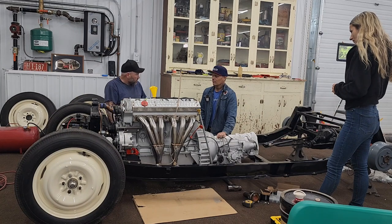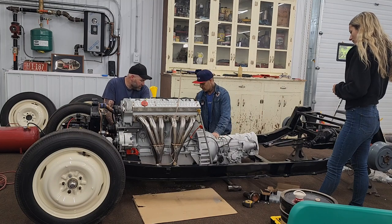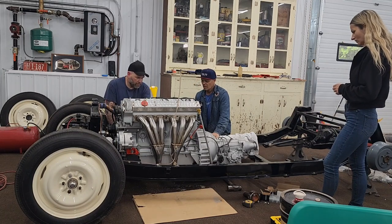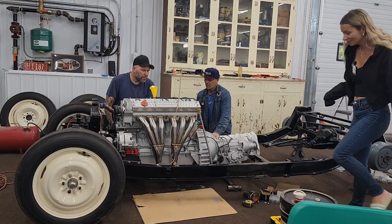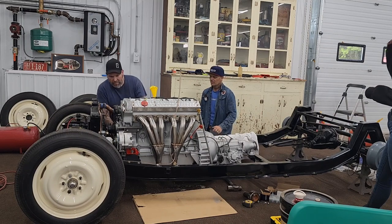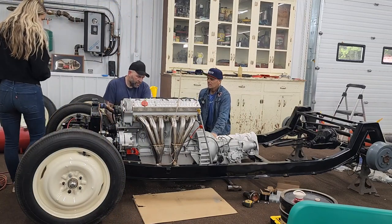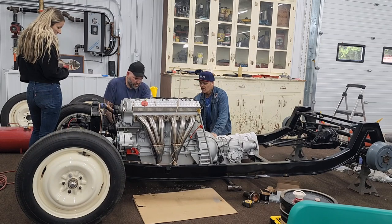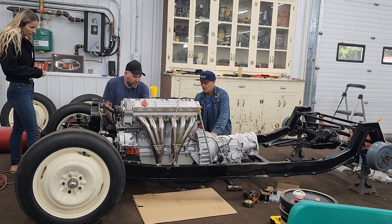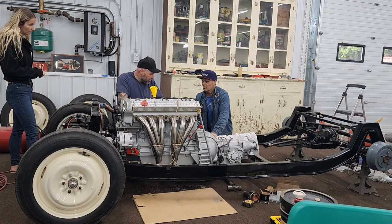We might have to pull them carburetors apart and make sure the jets are opened up in them. Is that what's going on, you think? She's not wanting to open up. Let's try her again. She's coming around. Starting to take some fuel now. Okay. Give her one more try, I guess. See if she'll idle. Yeah, I think we'll probably pull them apart and check the jets. We can give her some more fuel, though.